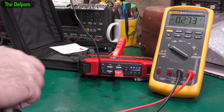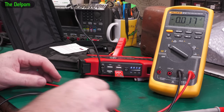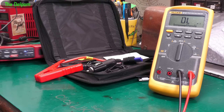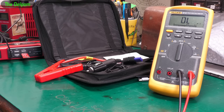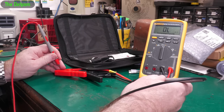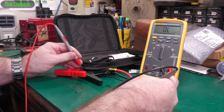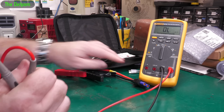So 16 volt max is potentially right. We have a change - it started flashing the 25%, I think it's coming to life. What I'm doing right now is checking these jumper cables. 0.2 ohms - yeah that's fine. Check the other one - 0.2 ohms, so the cables themselves are good.